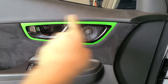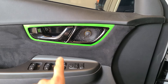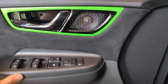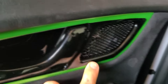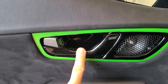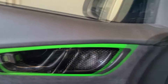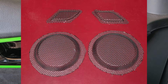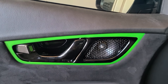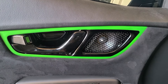As for this actual trim piece you see here, that's a combination of a couple different things. I had to get some laser-cut acrylic to get this shape just perfectly the way I wanted it, with a nice eighth inch roundover so it's soft around the edge. I did take this all apart and paint the handles. Instead of a red square there, it's now a green square. I got some metal mesh and did a pressed grill that goes in there as well. I did this paint scheme, which I'm pretty pleased with, although I'll admit I didn't do a very good job getting that corner as smooth as I would have preferred.